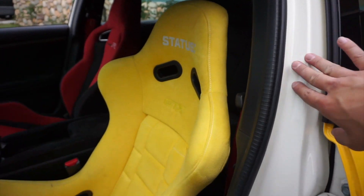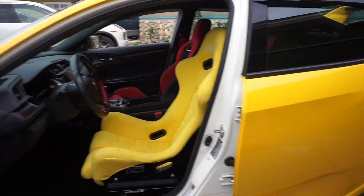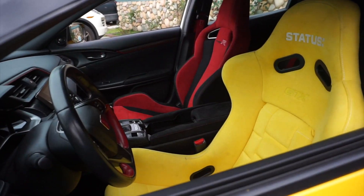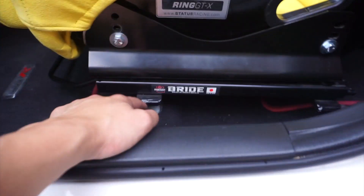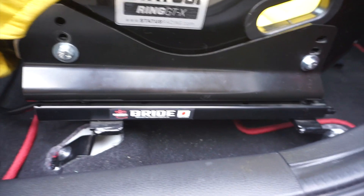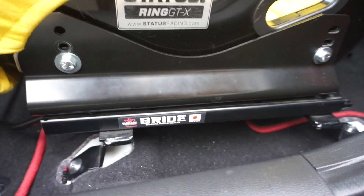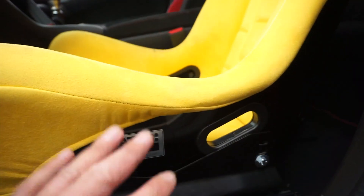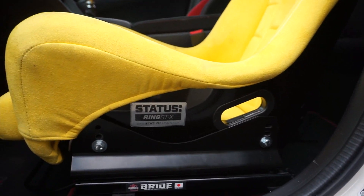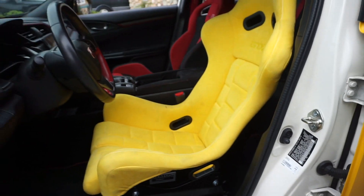Here's the ugly thing about wrap — the door jams are the same color as original, so it is a little janky, but when the doors are closed it looks fine. The seat setup right now sits a lot higher than it did stock, and that's for a number of reasons. This Bride rail, as good as the quality is — the build quality, how well it slides — these do sit quite elevated. So if you're looking for a lower seating rail, I would not recommend these Bride type FOs. The Status seat in general also already sits higher than a Bride or Recaro, so the combination of this elevated seat rail plus this seat — I wouldn't say that's the best seating position. It sits quite high.